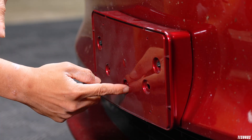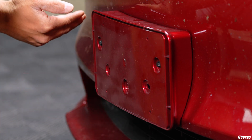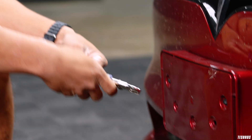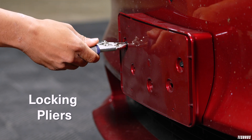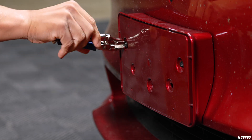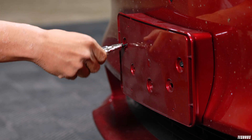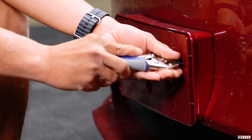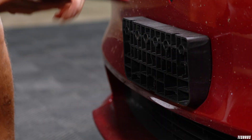There are three bolts right here — I actually took out the one in the middle. There are three bolts usually that hold it. This doesn't actually hold into the body of the car; it holds into a bracket. So once you get the measurement of the bolt right here, all you have to do is go into this hole and lock that up. Once you lock it up, you can see that you can start spinning it and loosening it. This is honestly like the perfect size because it doesn't touch the license plate holder if you're going to reuse it. There are three of these, and once you remove those three screws, this literally just comes out. Put that aside and you are left with this bracket.